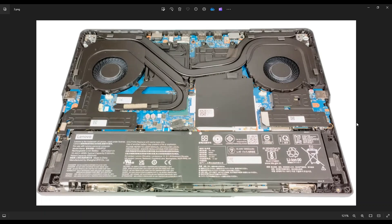Before I do anything in a computer, I always either remove or at least unplug the battery — it makes it safer to work on the other components. The battery is here across the bottom. There are five screws holding it down: two here, two near the bottom, and one hidden underneath the metal guard for one of your solid state drives. So you've got to take off that shield for your solid state drive first. There are three screws in it — one on the right, one bottom left, and one up near the fan. Once you get that shield off, you'll be able to access that screw right in there.